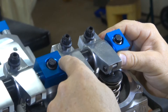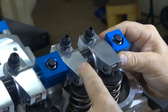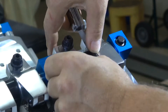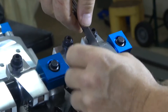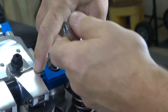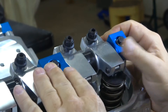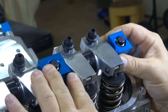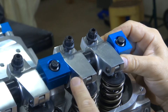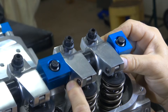So I've got to swap one shim from here and put it between this rocker arm and the center bushing. I have the shim swapped, got this clamp back in place, put my 40 thousandths in here. I do have some play with this clamp, so I'll put my 40 thousandths shim in, hold this, and pull the clamp to make sure it holds that place. Clamp this down, just to hold it, and recheck. After putting the shim from this side to this side, this rocker no longer moves off the tip of the valve.